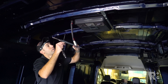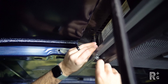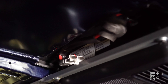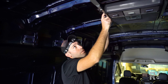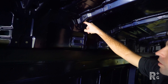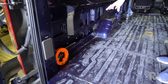We've got our longer installation bolts ready. We already have the one bar installed on the opposite side, so we're moving on to this side, taking care not to pinch our battery cable. We've got our installation bars all snugged up. The power cable is arranged in a bit of an S-formation — when we're ready for final install, we'll put a zip tie around the Anderson connector and secure it to the installation bar. The cable path runs through the roof support channel, and I've already got my fish tape run, coming down and across to where our battery system will be.